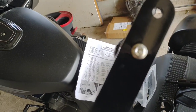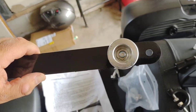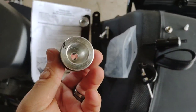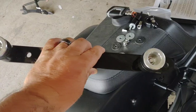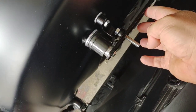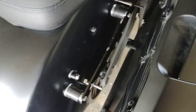You have an Allen bolt and a flange nut that goes through the original hardware — you want it on the inside of the bracket. Make sure you Loctite that. Here's the bolt, here's the nut, and you're going to do the same thing with the back part of this. The only difference is it's not going to go on the inside — it's going to go on the outside. That's what it's going to look like when it's said and done. Now you're going to put this on the exposed studs here, and I think that's why they want it finger tight for now — just so this lines up. Once you get it lined up, go ahead and tighten it up. The kit comes with four rubber washers — that's where you put them, here and here.